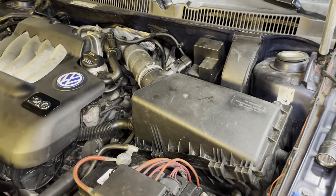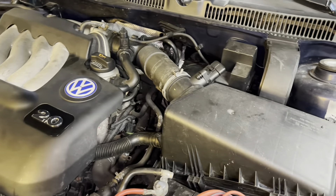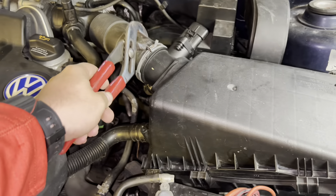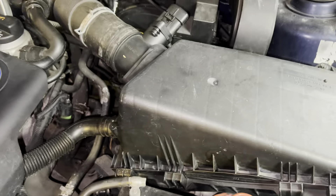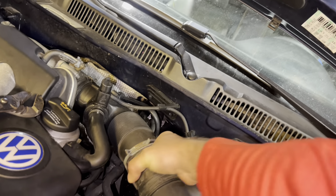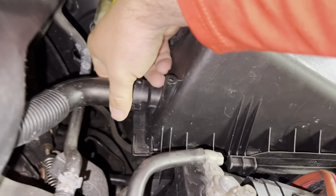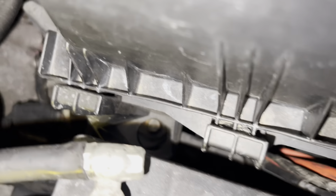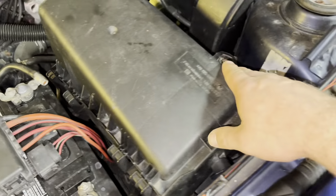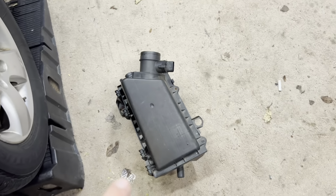The first thing we need to do — you don't actually really need to do this, there are some other videos out there on YouTube showing you how to tackle this repair — but this is just something I want to do to make this a little bit easier. So we're going to go ahead and get this air box out of the way. We need to loosen this clamp, so we're just going to get our pliers on here, loosen that clamp, and then get this hose off. There's another breather hose down here — just wiggle that loose. There's one screw here, so we take that Phillips screw out and then this whole housing should come right out. All right, so we got the breather box out of the way.